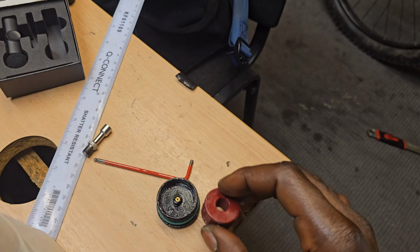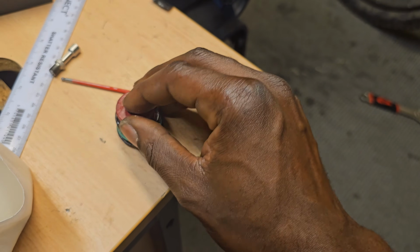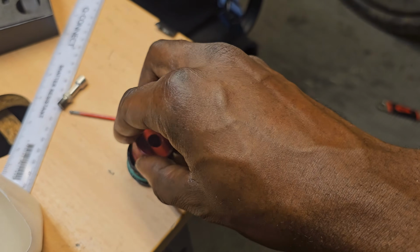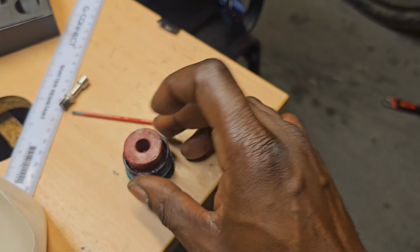All right, so something did come to mind actually. For those of you who recall, these are the really old RockShox volume tokens, which you could put into the older Pikes and the Selects and the Revelations and so on. These are designed more for a 32mm stanchion fork. Funnily enough, it does fit in, but it's not ideal. There's no method for it to screw in or attach. The only way you'd be able to do this is to essentially glue it in.